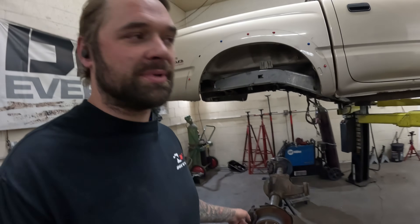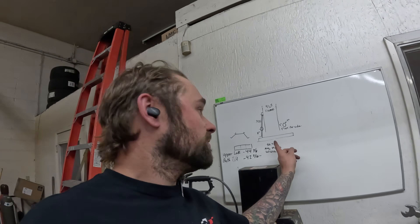We've got the axle in place, the bed's back on, everything is lined up. What I'm going to do now is take the lower link brackets and mount them to the axle. When we did Corey's first gen — if you've seen that video — I took a couple notes on the mounting width for the trailing arm brackets on the axle, so I've got a little cheat sheet. I have a set of 35s that I use as rollers that I'll be putting on this to center the axle within the factory wheel opening so we trim everything evenly when we go to a bigger tire. Once that's all in place, that'll let me bolt my trailing arms up and mount the trailing arm brackets on the chassis based on just where they land.